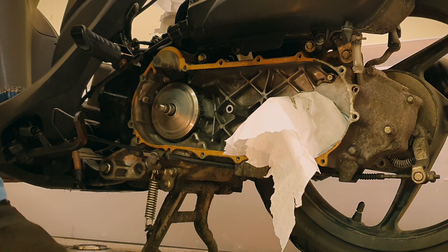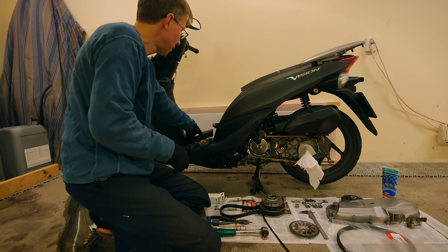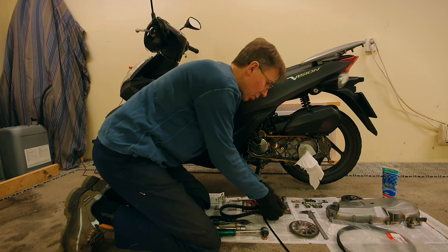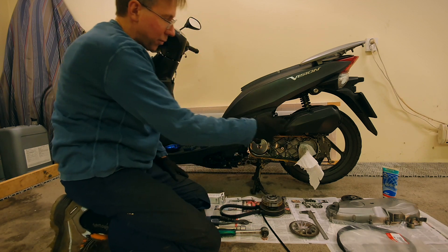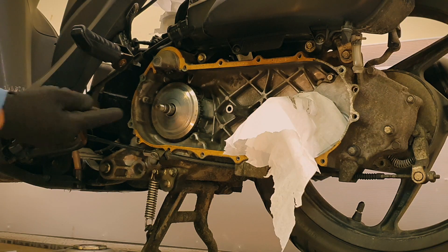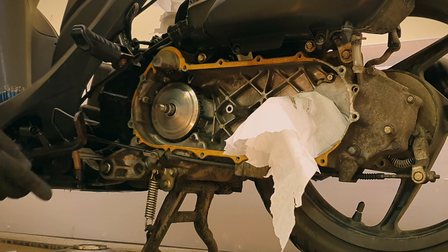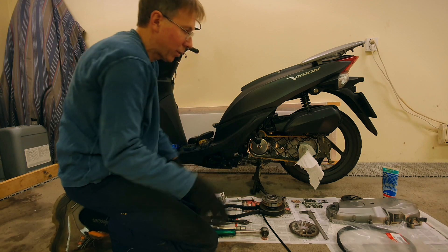To get this far, I've taken off this cover. First there's this little plastic thing that leads air into this transmission cover. At this point I have pushed and compressed things — there's a spring here, so this rear end of the transmission is just spring-loaded. As the variator compresses itself, the weights inside move and push this way, so it gets narrower, then this one climbs to a larger diameter. The force of this kind of forces these discs to go apart instead, and there's a spring here that pushes them back when the speed slows down.